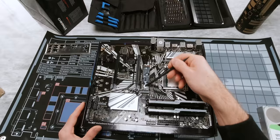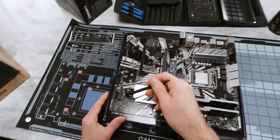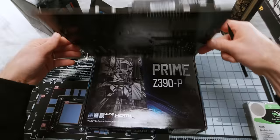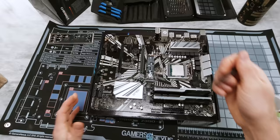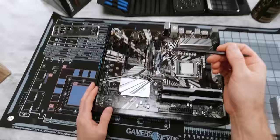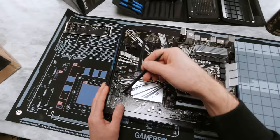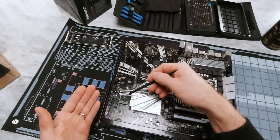So that's done, but I do have a couple more notes about M.2 installation. On our board both of the slots were easily accessible, but that's not always the case. Some other boards will have M.2 slots actually on the back of them — this is a space saving feature — and in some cases, even if they are on the front, they're going to be covered by a heat spreader or a shroud, so you may actually need to remove screws in order to find them. Those heat spreaders are actually optional. They don't tend to help the drive dissipate a ton more heat, but what they do do is act as a heat buffer if your drive only sees intensive use from time to time.